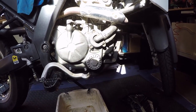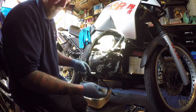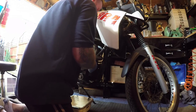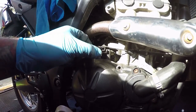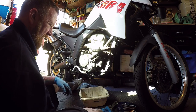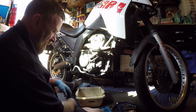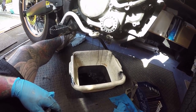Once under this they all come out. All these bolts are the same size so you haven't got to worry about marking them up. I've also adjusted the clutch lever now so I'll be able to undo it and take it out - just simply pop that out. Now this should move freely - there's still a bit there though, it's just not coming back completely. A little persuasion, just lever it here - and there goes your oil. It's a bit dirty, isn't it? Time for an oil change, I'd say.